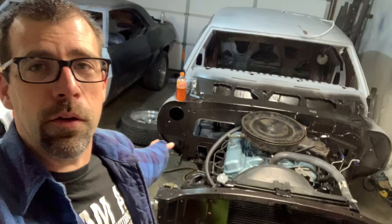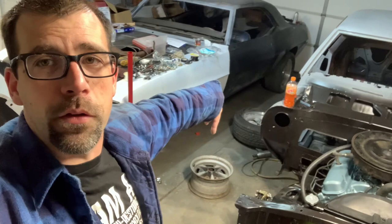A few episodes ago we put the subframe back under the front of the body. I was testing the rally two wheels there — they will not clear on the Great Pumpkin. Now the back-in-black high school car here works perfectly fine. They've both been disc brake converted, both use the Right Stuff part number, but this one isn't Right Stuff brand. In their defense, they didn't say it would work with 14-inch wheels. Out of the box, quick throw it on — they look identical — but there are some differences I wanted to show you in case you're in the same position and need to know what to do to get it fixed up.